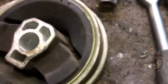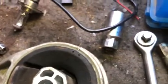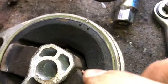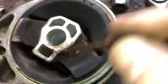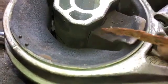Had to jack the transmission up just a little bit, and then had it flipped up like this, then flipped it, and then brought it straight up from the back of the engine. But looking at it, it don't look that bad until you get close here. You can see the crack. It splits. Man, I tell you, get something to point with. Okay, right down. See the crack? Comes all the way around, and then same thing on this side. It's cracked right here.